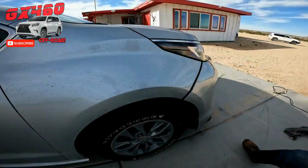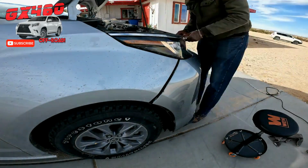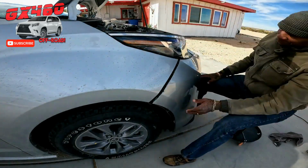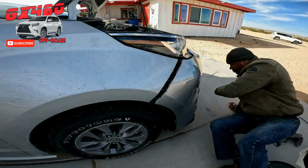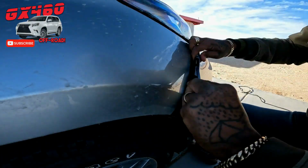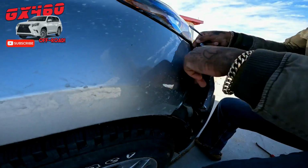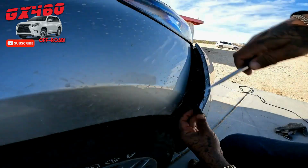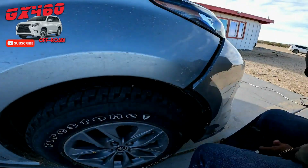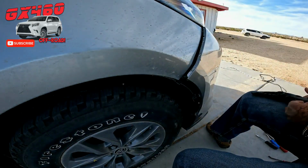So the plastic retainer is this. Oh, we bent under the hood. There's a piece, like a plastic bracket on the headlight, that's broken. So we're going to weld that later, plastic weld it with a soldering iron. So we got all sorts of nonsense repairs going on here. But anyway, that's the plastic retainer in there. Those black clips clip onto the bumper, but the black plastic retainer should be attached to the metal fender, the passenger side fender. And there it is right there. So it just basically sheared off its plastic clips that were attached to the bumper.